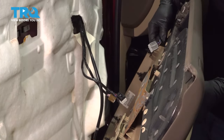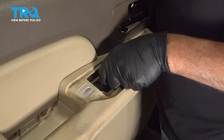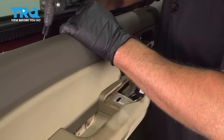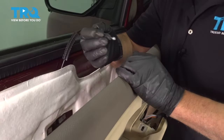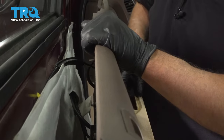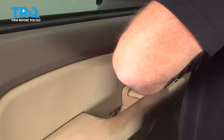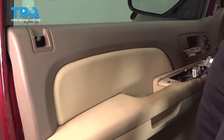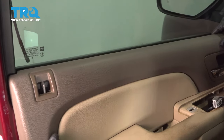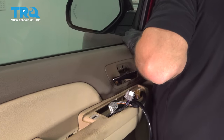Slide the door panel back in place and slide the wiring harnesses through here. Connect this cable over here — that's going to go through there and then pop in place just like that. Lift up on the door panel. There's a groove on the top — you need to slide that into the weather strip. Now with the door push pins lined up, re-secure the door panel.